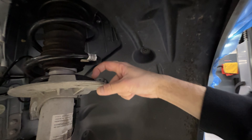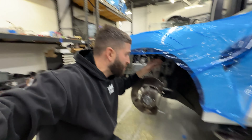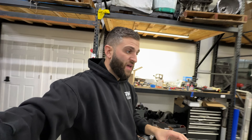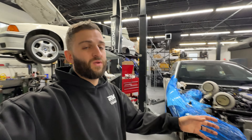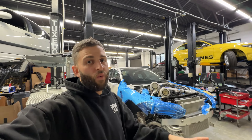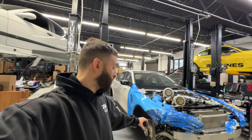We do have a small issue with the shock — this area is a little fat compared to the spring, and the tire is going to touch it depending on offset and tire diameter. You're kind of limited: if you put a tall tire it's an issue, if you put a short tire it's sort of okay. I want a taller tire, so I reached out to the guys at BC Racing. I ran their coilovers on my F80 M3, went 9.1 and launched — had zero issues. Most brands, if you buy a custom coilover, can valve it how you want and give you whatever spring rates and travel you want. BC Racing is going to hook me up with proper coilovers that allow a small amount more lift in the front for potential weight transfer to the back.